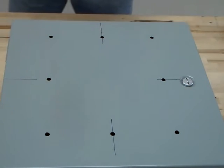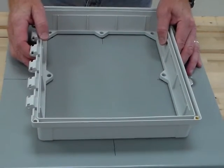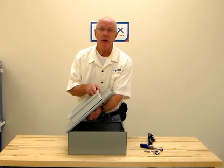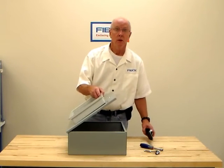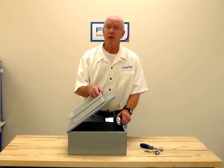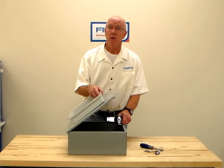locate and place the IP frame with the mounting holes. Hand tighten the 5/16 bolts and nuts in the order shown on the template. Torque these bolts and nuts as shown on the template. Torque the bolts and nuts to 53 to 80 inch pounds, or 6 to 9 Newton meters.